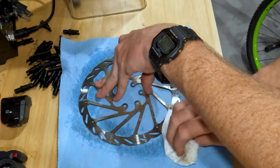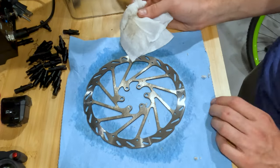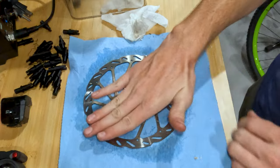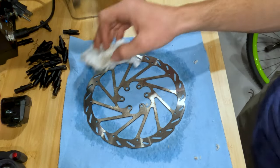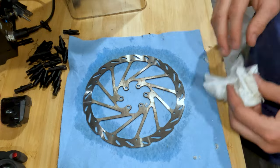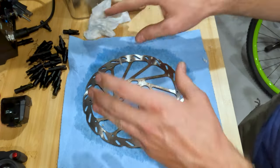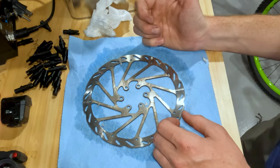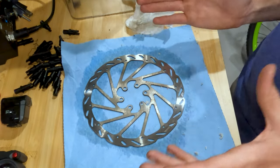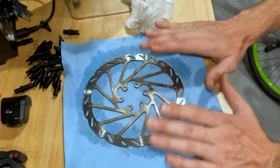Now, if this doesn't work and after you bed in your brakes you notice they're still squeaking, there is one more thing you can do. Sometimes the residue from the brake pad is really stuck on there. You can go around with some medium to fine grit sandpaper and do small circles all the way around the brake track as evenly as you can, very lightly, then wipe off with alcohol — that's going to reset the surface. New brake rotors have a much rougher surface meant to catch the right amount of brake pad residue for good bite. Be careful not to go too heavy on the sandpaper or that will make your squeaking worse, so I like to see it as a last resort.